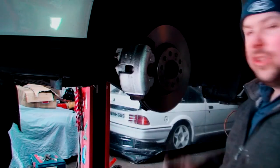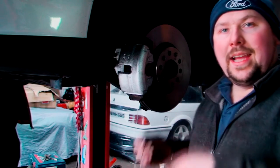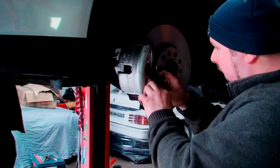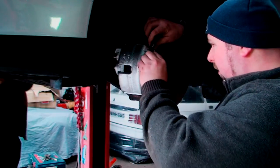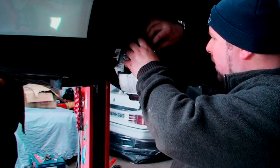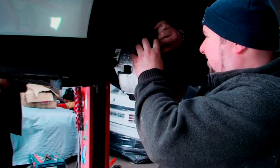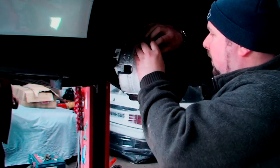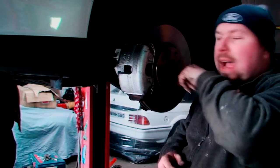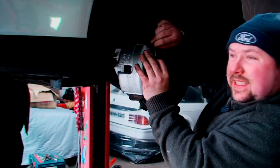Now, I'm going to turn the wheel now, tighten them up. We're getting there. Now what I'm going to do before I tighten up the caliper, I'm just going to put this spring in, which can be annoying and it can hurt if it slips out. So push one end in, try and bend the other end around. Hopefully, oh, so I push one end in, the other end in the hole. I'm trying to bend the top of that out while keeping it in the hole. It's easy.